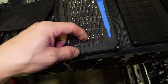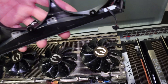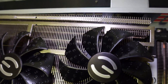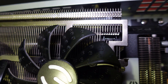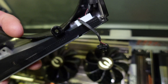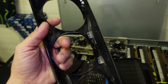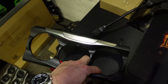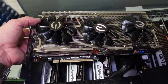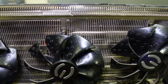That just comes off like that. There is a little clip here — a little RGB plug that goes in that slot right there. You have to put a flathead in and pull the wire up to release it. Unfortunately we won't have any more RGB, but we're going to save wattage by not having that inside the Octo Miner. This is what the GPU is going to look like with the fans attached.